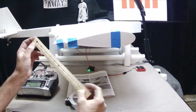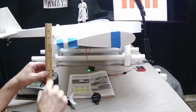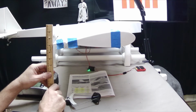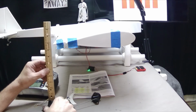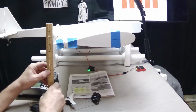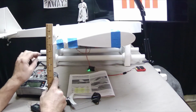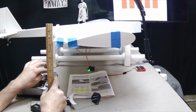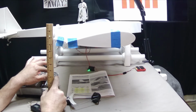Okay, back to measuring. So a ruler is a good way. Get something to stack under the ruler to get it to where it's at 3 inches exactly, for example. And then you can measure the travel that way. So let's go right here. Well, I'll just kind of hold it for demonstration here. So we're in the low rate setting, and I've got it centered on 3 inches right there. We'll go this way. And right there is about a 1/2 inch. And there's back at our about 5/8 or so. Let's do our high rate. And that's almost 7/8 of an inch.